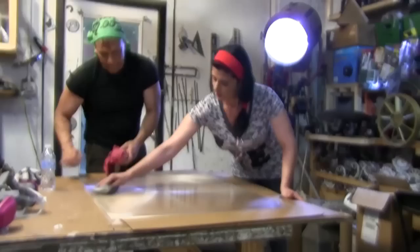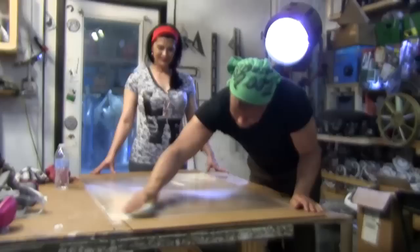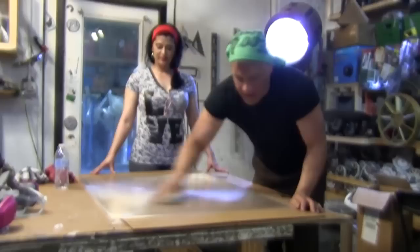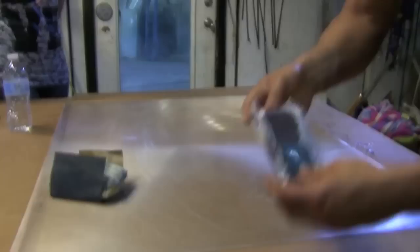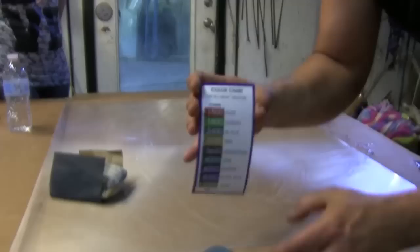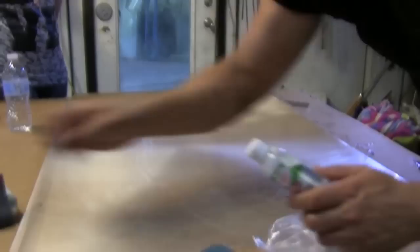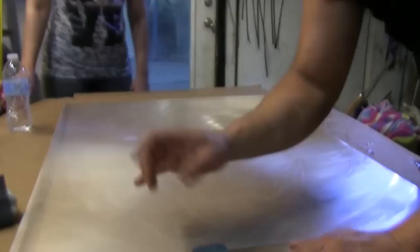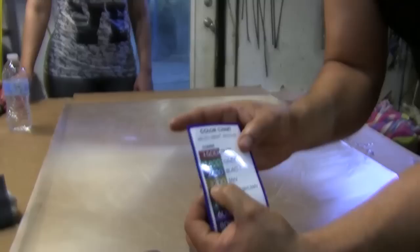You want to do the entire lens and work especially well on the edges. Depending on the lens you're using, this whole process can take anywhere from 30 minutes to 3 or 4 hours — it depends on climate and the type of lens. This is called micro mesh: little sanding pieces that go from 1500 all the way up to 12,000. You can try to jump ahead using something for car headlights — basically a car polish with a very heavy grit — but I found that jumping ahead actually takes more time. We're going to do the 3200, then the 6000, then stop there and take it outside to hit it with a buffer.